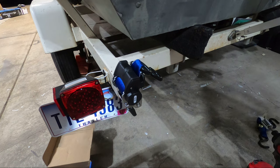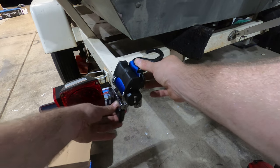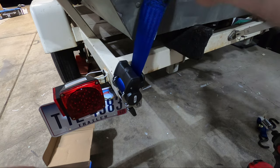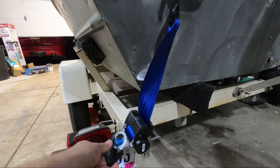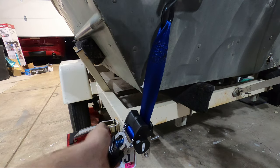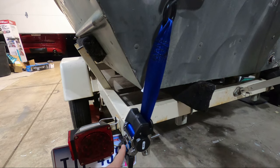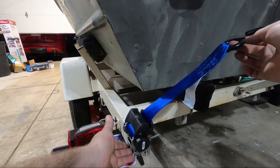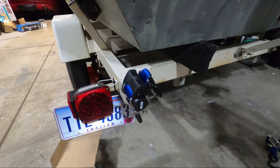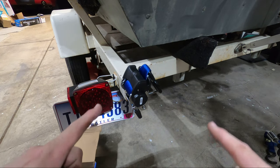This always sits on your trailer as-is. When you're ready to tie up your transom, you unlock it from the bottom — there's a blue tab. You unlock it and push it all the way down, which lets it come out freely. You hook it onto your transom, hold the blue tab, and pick it up so it's in ratchet mode. You ratchet it down and you're fully secured and ready to take it on the road. When you get to the boat ramp, press the blue tab down again to unlock it, this just comes up, you take it off, and then — my favorite part — you push the blue tab again and it retracts right back onto your trailer. You never have to find them. By far my favorite boat trailer upgrade, bar none.